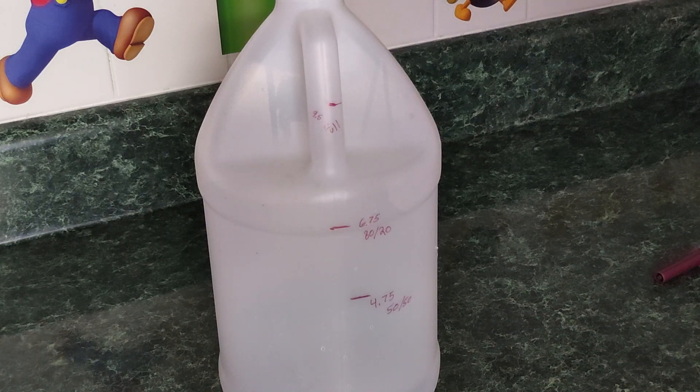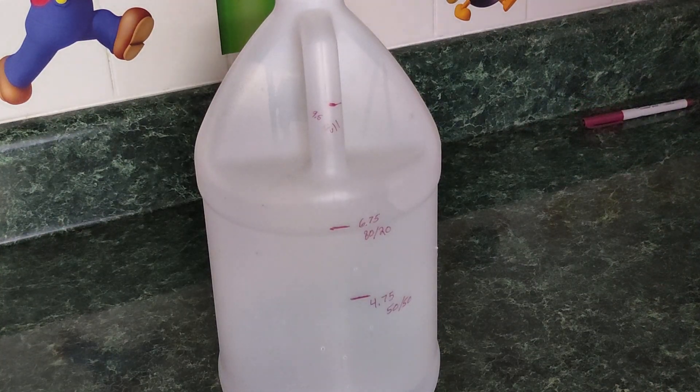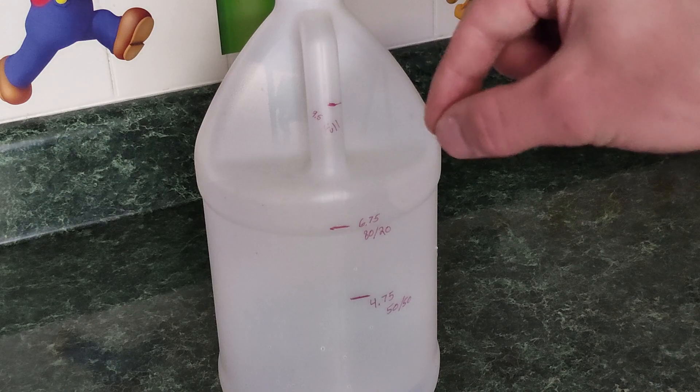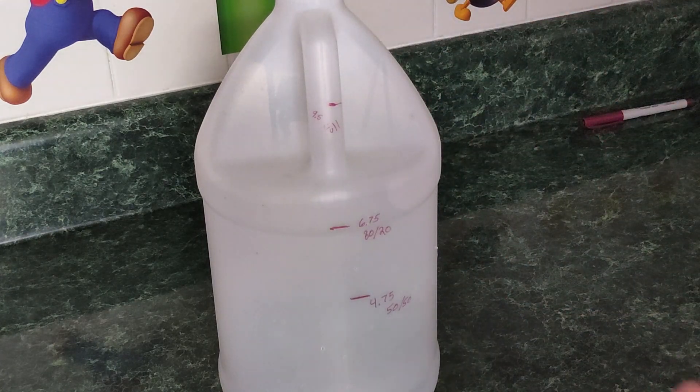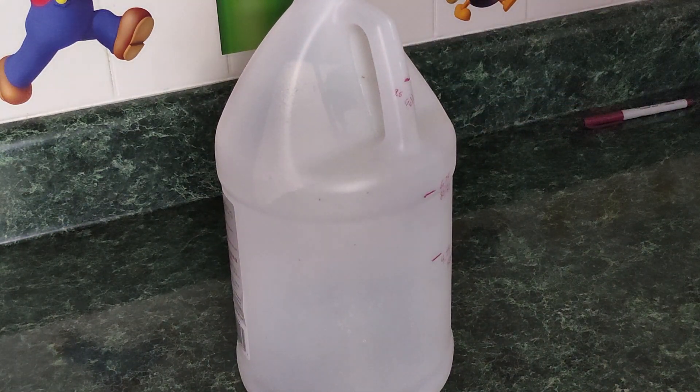Remember to filter your methanol when it comes out of the container. It doesn't matter if it's VP Racing or another brand — if it's not lab-quality methanol, run it through a filter. It would be a good idea to have a filter in line before your methanol pump. Make sure it is a methanol-stable material, because some filters will melt. To test it, dip the filter material in pure methanol and let it sit for a minute — see if it starts to degrade, melt, or catch fire. Most filter medias are polypropylene, and this jug is HDPE, which is somewhat similar, so it should be fine.